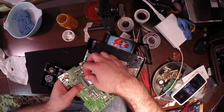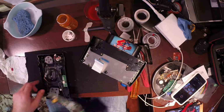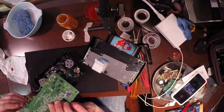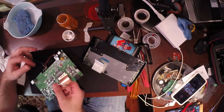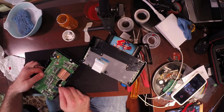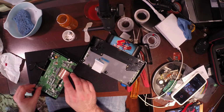Alright, so again, I'm going to remove my ribbon cable because I don't want to tear it, and I don't need to be a brave soldier here anymore and screw with that. So how this was oriented was like so. Now what I did was I put a dab of hot glue here on the wires so that, God forbid, there is tension, because someone always does try to go inside and reinvent the wheel. Now route this speaker wire into here like so, and this is our start and select speaker wire for that board. Make sure you keep these tucked in there like that, okay?